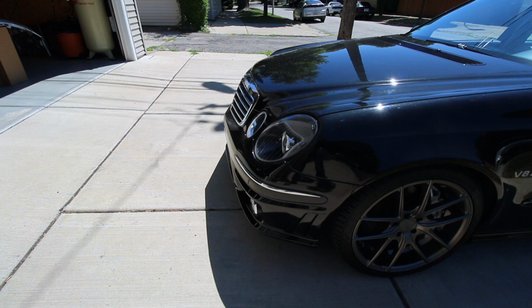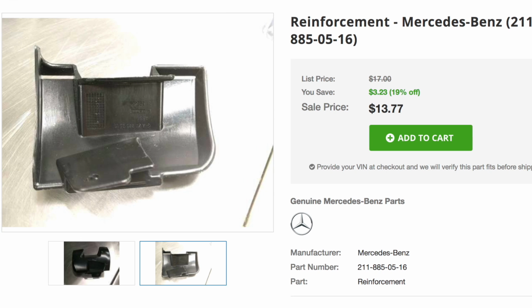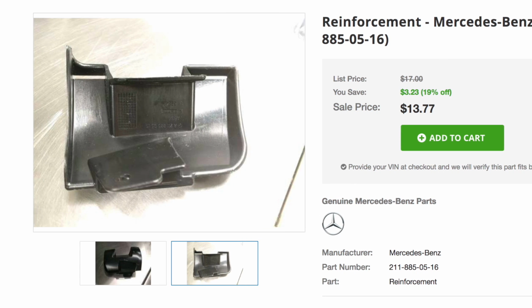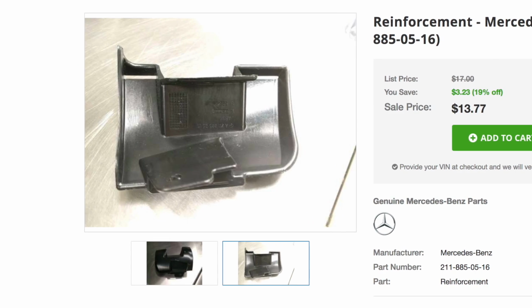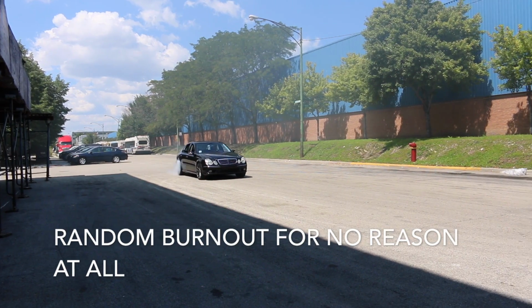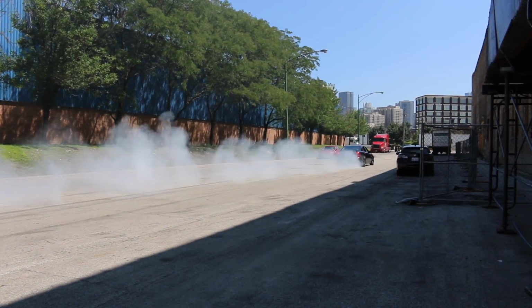Okay, we got to pause here for a second. That flimsy plastic bracketry that I showed you a little bit earlier ended up really bothering me because the fender liner was just way too loose. So I found out that you can order 2 plastic brackets and glue them into the inside of the bumper, and that should hold everything a lot better. Also, there is no hardware included to attach those grills that are around the fog lights, so you'll need to go to the hardware store for that. But I'll leave part numbers for everything in the description box down below.